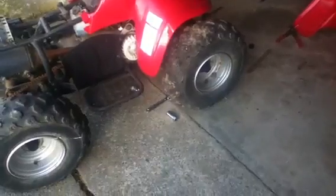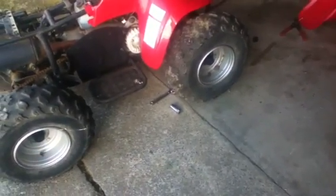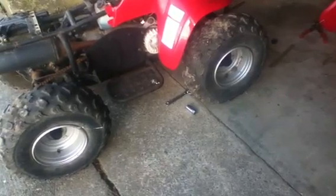He said the CDI might be the problem. He did have the cover off, so that could also be part of the issue. We'll take a look underneath that stator and see how the windings look. If they're all corroded, that's probably the stator that's bad because the windings got all corroded up. If there's still connection and the windings look good, the stator should still be fine. He's also concerned about this pickup coil here — not sure if it's gapped enough, so I'll double-check that. I did notice there's a lot of gunk inside the cooling fins. I'll blow that out, make sure it's real clean, and probably pressure wash it, because it's not good — it'll overheat the engine in a hurry.